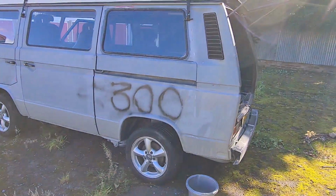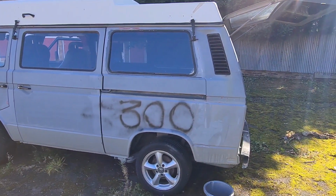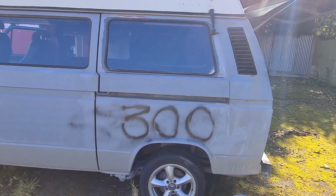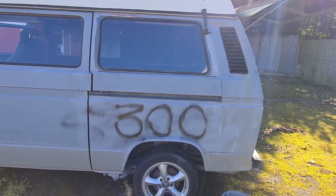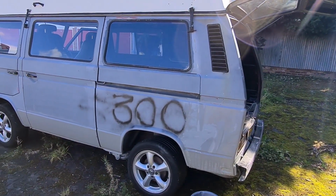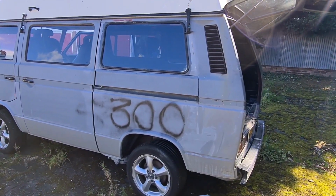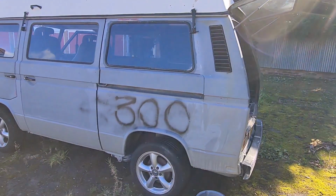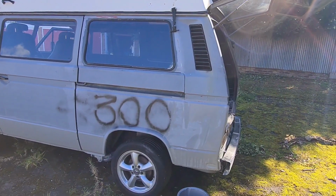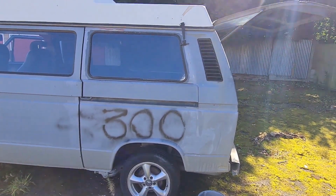So then, let's get this side ready for paint, possibly next weekend. I'll see what we get on with in the week. We know that repair there, we know that we rolled the primer on, so it's going to take some work flattening all that off. If you've been watching the videos, it's been guide coated with our 300 subscriber mark. Now I'm going to try and flat that off and get it all ready. It will need another coat of primer, but I'll spray that on this time instead of rolling it on, and then that quarter will be ready for paint.